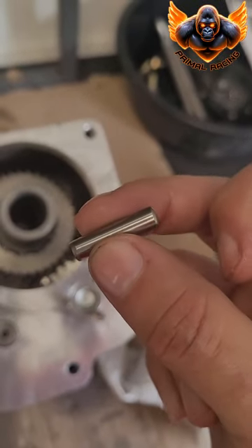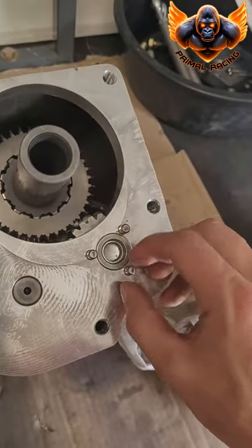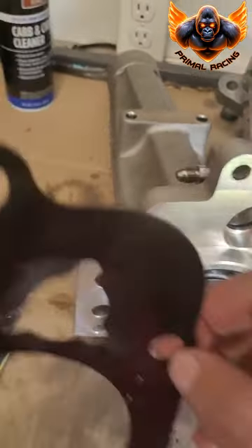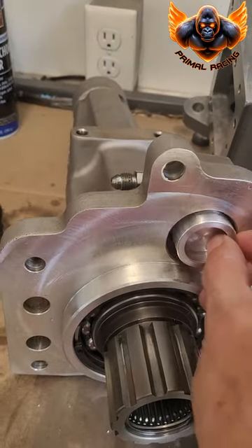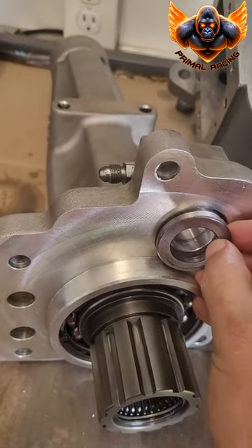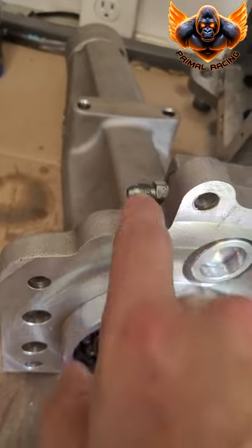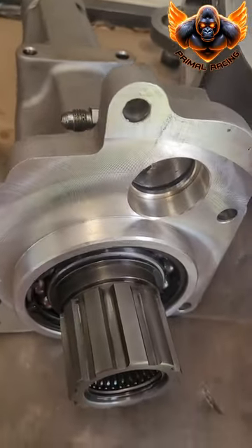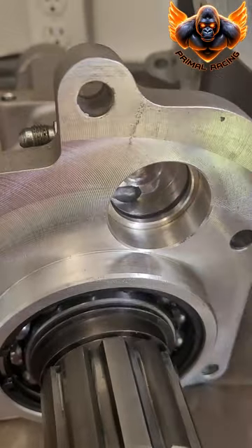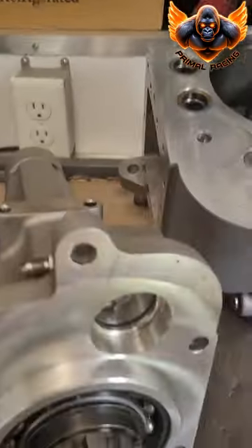One side of the pins is a little more rounded than the other — I'm putting the rounded side up so it's easier to mount the tail shaft. The tail housing has a gasket we're going to replace. There's also a piston: take out the thrust washer on the outside, squirt some carb cleaner in to shoot the piston out, and there's an o-ring behind there to replace. Then put the piston back, the thrust washer, and the gasket.